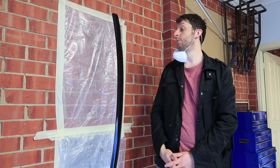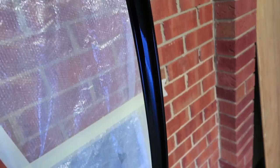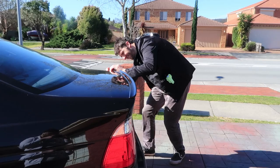I've just finished putting on my last coat of clear coat and we're going to leave that overnight — possibly about 12 hours — to give it plenty of time to harden so we can fit it on the car without damaging the paint. Once the clear coat has had ample time to dry you can fit your part. If there are any defects in your clear coat you can wet sand these out and use some cutting compound — like a polish — to remove any sanding marks or hazing.